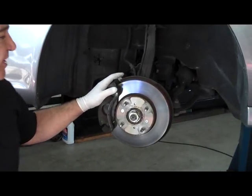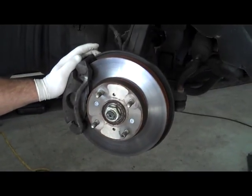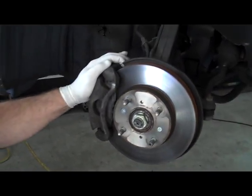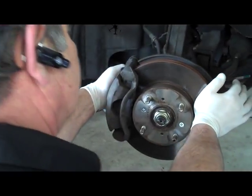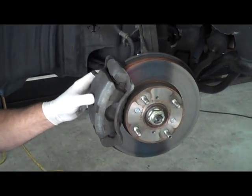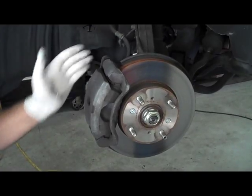Lift the hood and pull the brake reservoir cap so the pressure will be released when I pull the pistons back — I'll talk more about that when we get into it. I've already taken the wheels off and we're going to proceed to change the brake pads and rotors. The reason you want to leave the car in neutral with the key in is so you have the capability to move your front wheels for a better working position.